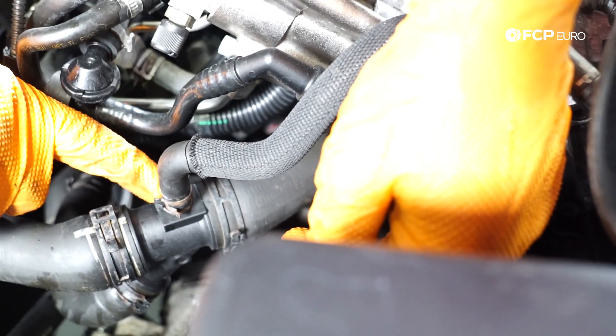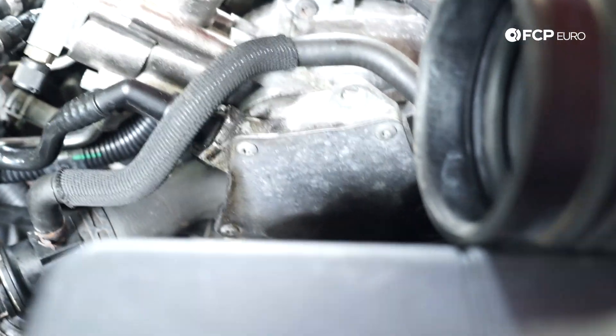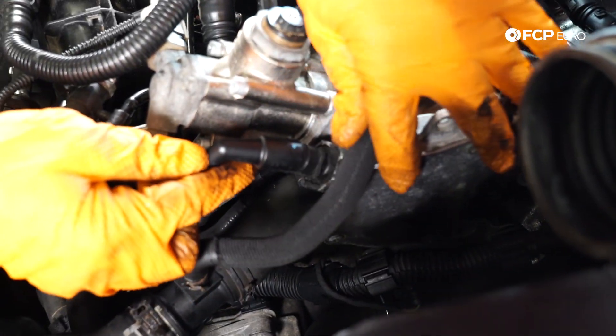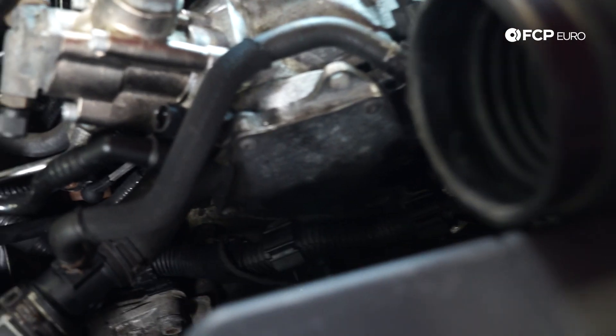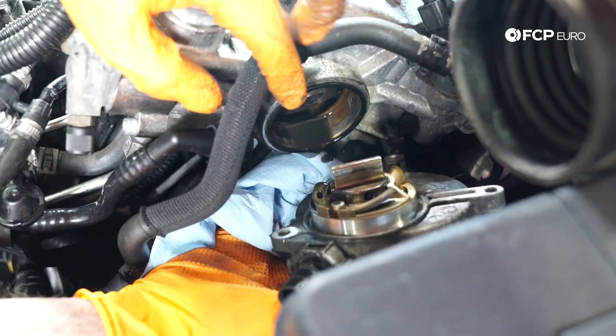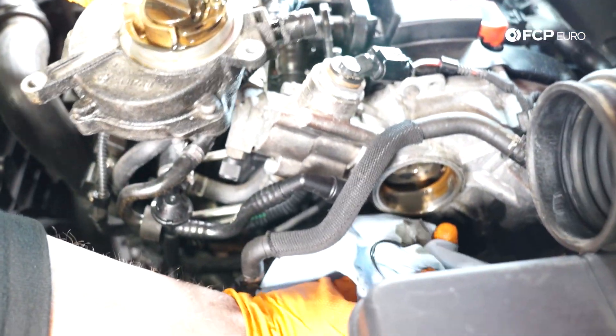When you're working around your coolant pipes here, you do want to be careful. This particular coolant pipe will kind of get soft over time, and if you haven't replaced it and you nudge it, it's very easy to break — ask me how I know. There's one more bolt located right back here by this harness; you can just feel it there with your finger. Once you have your three T30s out, all you have to do is pull the vacuum hose off and the whole pump will come off. There'll probably be a little bit of oil that leaks out, so have a rag handy. It should just pop right out, and you can see the O-ring or seal is stuck to the pump.